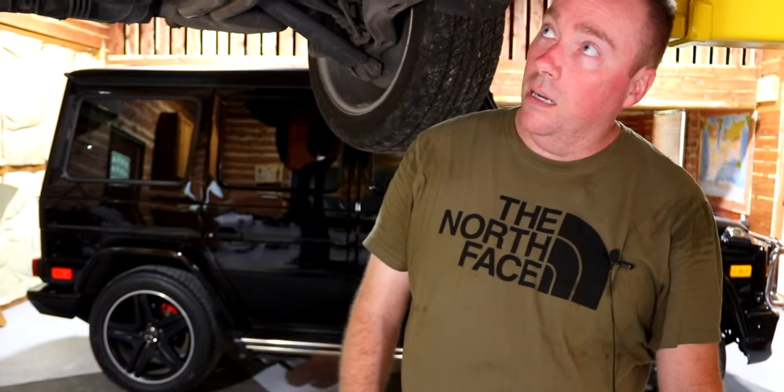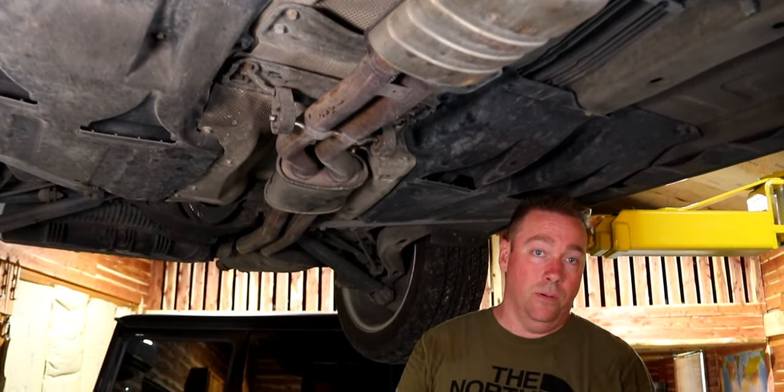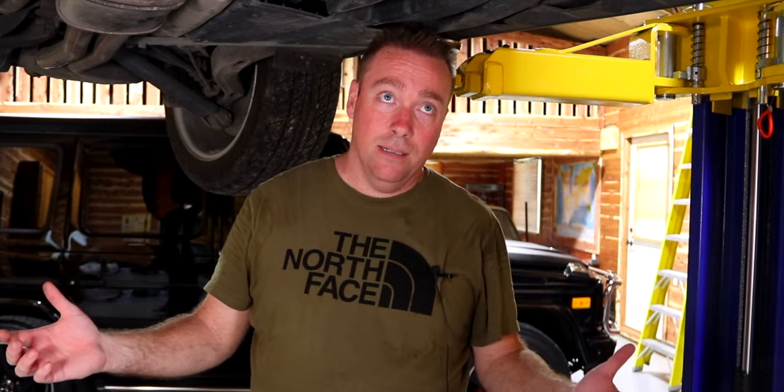Everything's back up — really not that big of a deal. We have a lift, but if you lay on your back on the ground, I've done this job many many times — it is possible but it sucks. It's better on the X3 because it sits higher. We've done this on E39 and E46 — definitely not a fun job. We got lucky the Guibo looks perfectly fine and nothing came apart with the center driveshaft. If you keep driving it when it's bad enough, in theory it could break that loop, come apart, and bust up everything in there. On this one it can't really hit the gas tank because the gas tank is so far back, but it definitely breaks a lot of stuff and you don't want that going on. That's going to be it guys — all for the E83 X3 driveshaft extravaganza. We'll see you back very soon with another video.